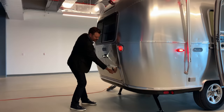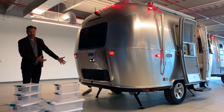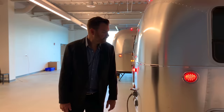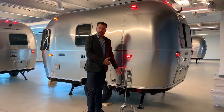The rear storage on a 16RB is a lot — it's insulated and weatherproof once locked, and all of our exterior storages are lockable. The rear window also opens up for greater ventilation. Moving around to the roadside, we have our 30-amp power center. The 30-amp shore power is needed to run your AC and your microwave. Everything else on the inside can run off the house batteries, but those two items do require shore power or a generator.